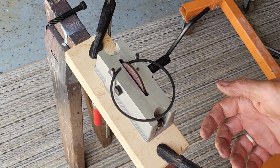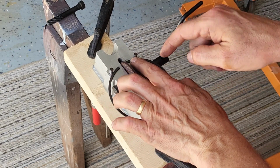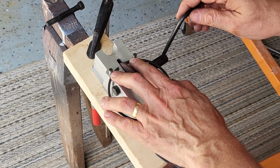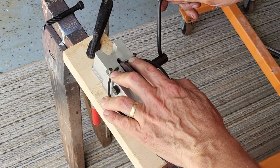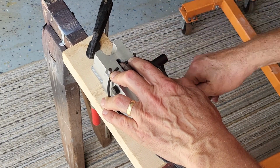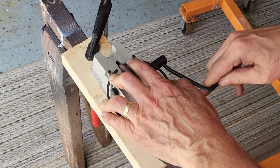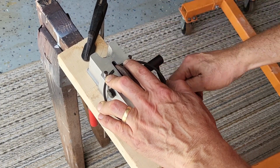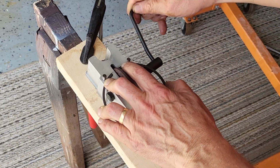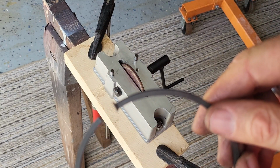So this is where I'm going to do 40 turns. I basically make sure I'm up against the wheel, the grinding wheel, and the 2 pins here. And then I provide a force going towards the wheel as I turn the wheel. So, ready? 1. 10. 20. 30. 40.